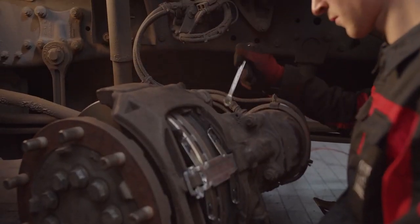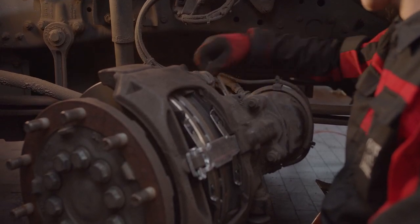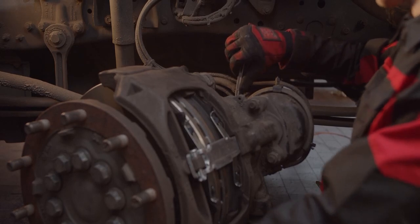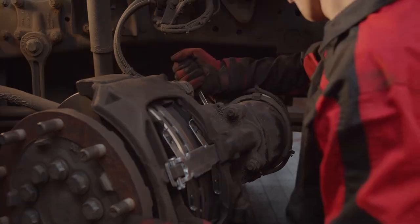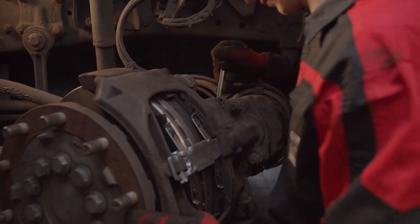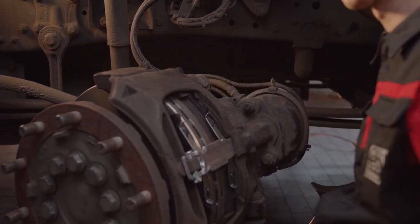After placing the brake pads in the caliper, the clearance between the brake pads and the brake disc has to be adjusted. Turn the adapter clockwise until the pads come into contact with the disc. Do not overwind the adjuster. Then turn back the adjuster 3 clicks and check the running clearance. The adapter for the adjuster is included in the Febi brake pad kit.